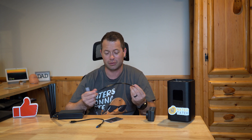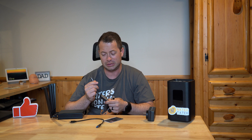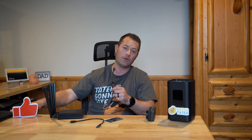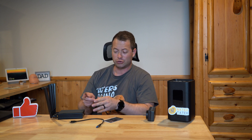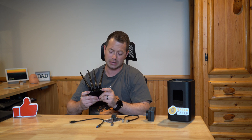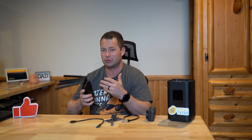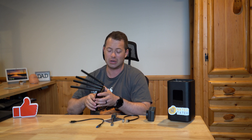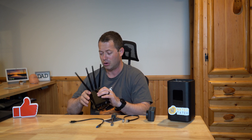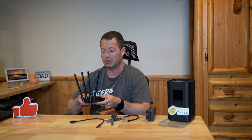It also includes a little one-foot ethernet cable. I personally also have an ethernet-to-USB-C adapter so I can plug my phone or tablet directly in, since there is no Wi-Fi — you do have to be hardwired in some form. The device also has two SIM card slots in the back just underneath the antennas. It doesn't have two modems so you can't run two SIM cards simultaneously, but it can do failover or load balancing to pick which one you want running.